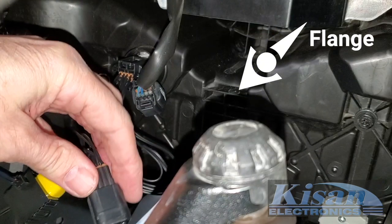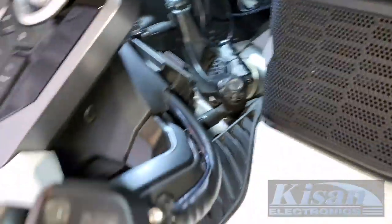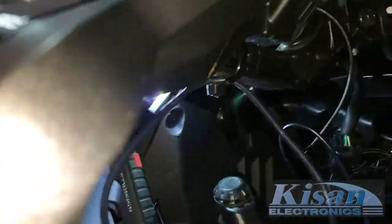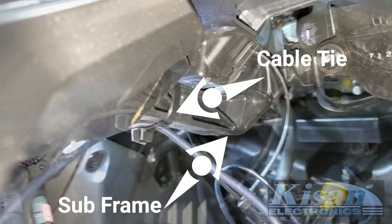I'm going to secure the Pathblazer modulator to this small flange — it's like a little shelf of plastic on the back of the headlight assembly. You want to make sure you clean that little plastic shelf area before you use the double-sided tape to stick down the Velcro pad. I'm going to temporarily mount my daylight sensor to this hydraulic brake hose coming off of the right handlebar. I will permanently mount this sensor at a later time and do a different video on that. I'm just securing the cable to this little subframe piece, and I'll bundle up all the additional wire and cable tie it to that frame as well.